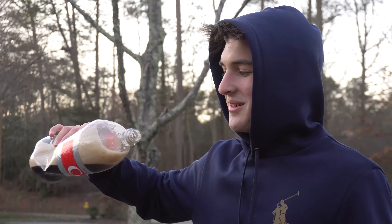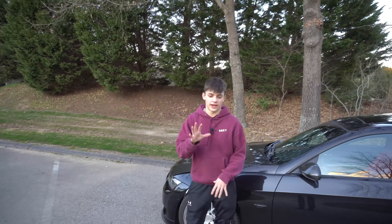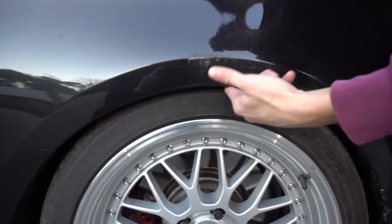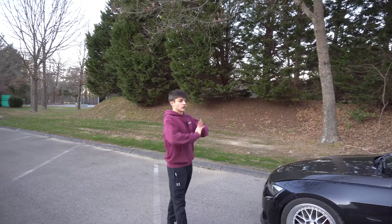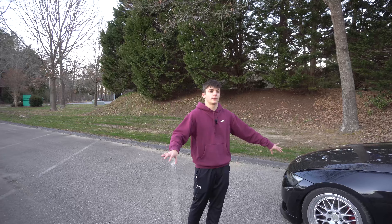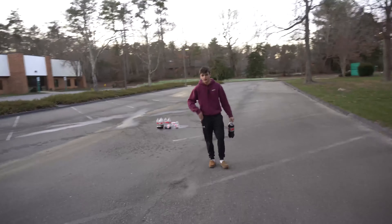Number eight: wheel spacers. These can be over a hundred dollars but they really don't need to be — mine were under a hundred. I have 18x9.5s on here, so I did have to adjust camber and get spacers to get the fitment right. In the back I have 35mm spacers so the fitment is pretty tucked — you can barely fit your finger in there. In the front I have 15mm spacers, really flush. Spacers are perfect to get fitment spot on. ECS Tuning has a kit where you can rent a bunch, figure out what you need, then buy the right ones.